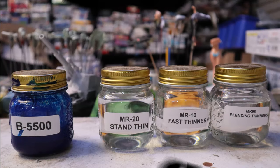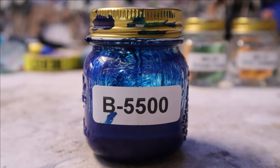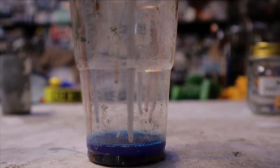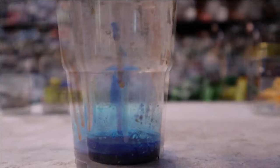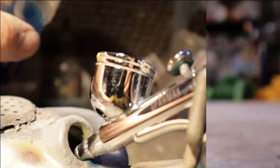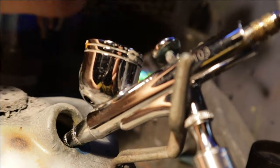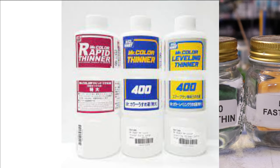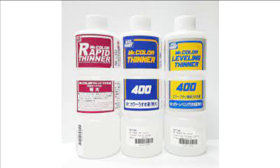Base colors and thinners: polyurethane lacquer base coat — in layman's terms, your color paint — sits between the primer and clear coat. It comes in the viscosity of mud, is very glossy, and is thinned or reduced by a ratio of one-to-three. To test viscosity or how thin the liquid is: swirl or spill the paint in a clear container — transparent is ideal, opaque is too thick. Every thinner has a job. The choice is overwhelming yet simple, as the name dictates the job and personal preference.